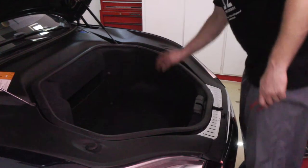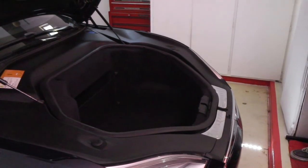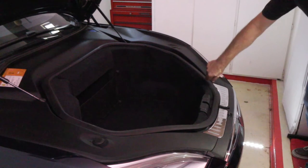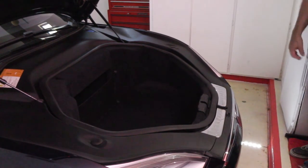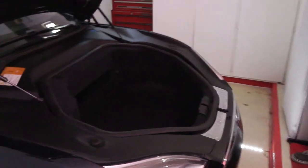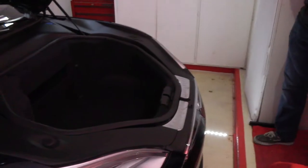It actually does monitor the 12 volt voltage and also the current going in or out of it all the time. So that's how it assesses the health of the battery too. If you start applying a little bit of current and the voltage shoots way up, it's not absorbing any current, so this battery is shot. So it can assess batteries that way.